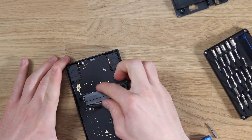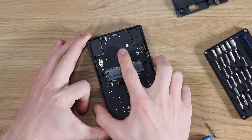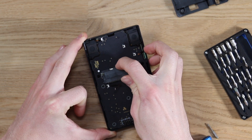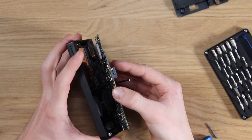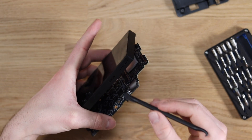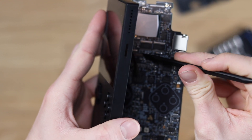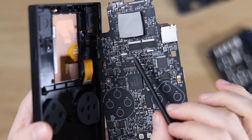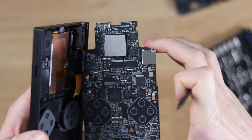The motherboard will now completely lift out — just be careful of the screen ribbon cable which is around about here, and also there's a thermal pad up here on the larger FPGA chip. Sneak in a little pry tool underneath and lift off the ribbon cable. There's the ribbon cable connector just there — it's a Lego brick connector, so be very careful with that. And there we have it: the inside of the Analog Pocket.